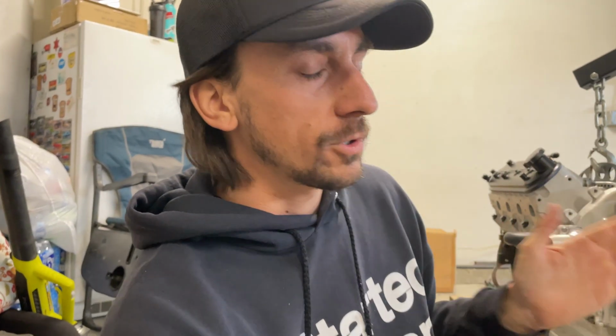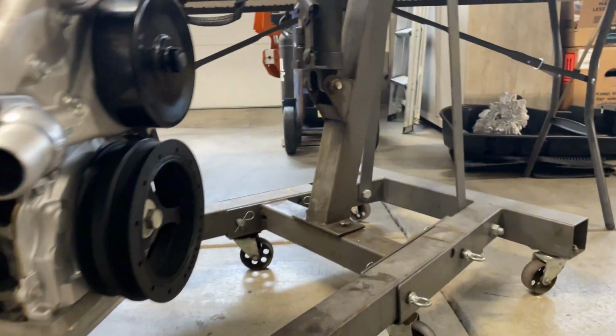That's gonna put the accessory drive kind of in the middle, not super close up against the front of the engine and not sticking way far out. And the third one is all the truck stuff. The truck stuff sits way further out, and that's great if you have a ton of room or if you're putting this stuff in a truck. Like I said, they all work as long as you keep everything in the same family so that your pulley system is on the same plane.